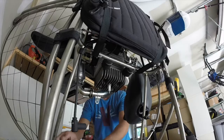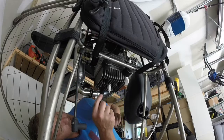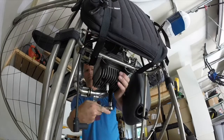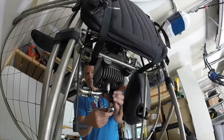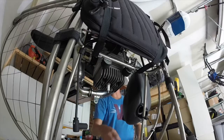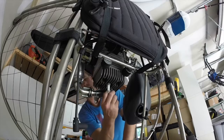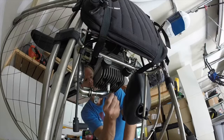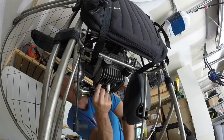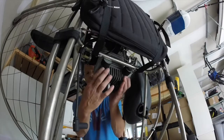Underneath this bracket, here is where the last two head bolts are. I'm going to continue to use this 12-millimeter deep socket and loosen those up. There are some washers connected to this — I want to make sure I keep them in the right order. There's a large and a small washer, and the small washer goes right up against the nut. Now that I've gotten all the head bolts removed, we just need to slide this head down.